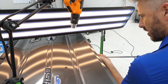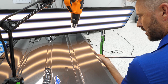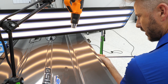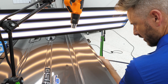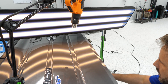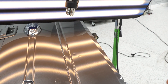So you've heated the panel a little bit — does that help the paint? It helps durability and pliability of the paint; it's just going to give me a little bit on the metal. Because these are so deep and driven in from whatever hit it, you can see it's a term that we call 'volcanoing,' where no matter how much pressure you apply in the beginning with a rubber tip, the edges are going to want to come up before the center does.